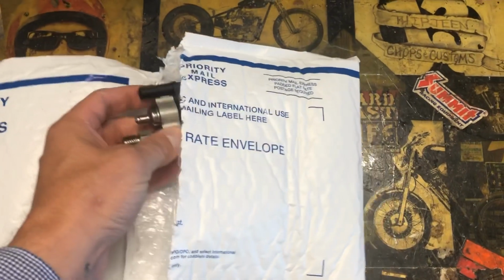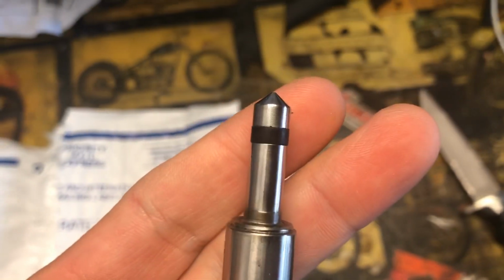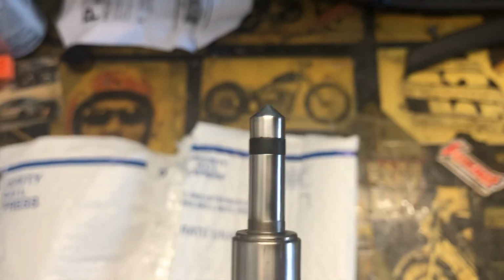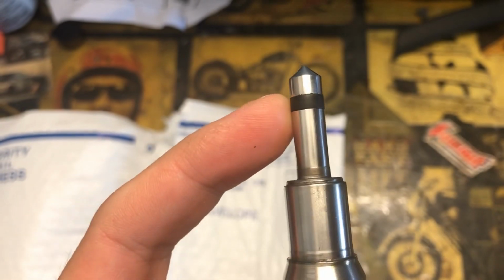The decoupler rings are installed, but they did say that they had the plastic, supposedly new seals. They do appear to be new, but they don't have the little plastic sleeve on them, so that does concern me a little. But I can do the old pen cap trick just to make sure. I mean, they fit on there pretty tight, but they're supposed to sort of expand.